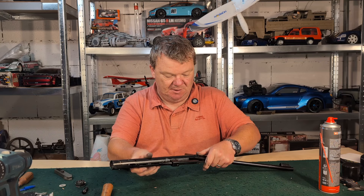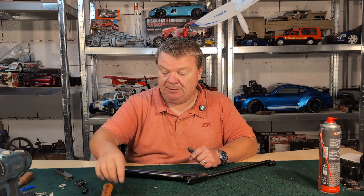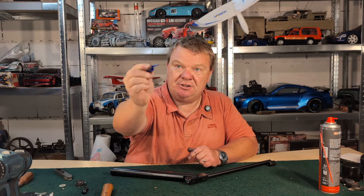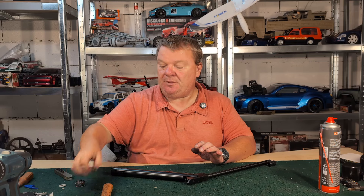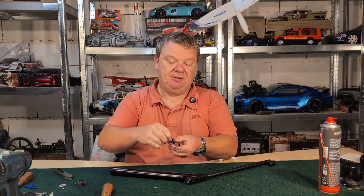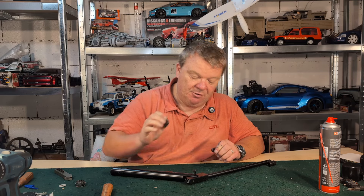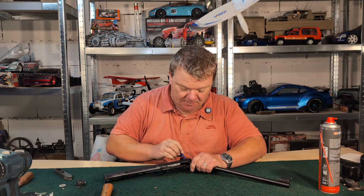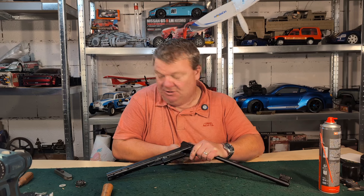That pushes through the tunnel and then drops into the piston — it's in its channel. Now we want to line up the barrel before we've put the spring into the gun, because then you're not fighting the spring on the detent that holds the barrel shut. We get our shim that we've just given a little rub with some Bum Slide, pop it there, and then we get our old friend the Bic pen lid. Use the sharp pointed bit of the pen lid to get it in there and then the rounded end to line it up. We take off the nut and one of the locking washers, give the shaft of the bolt a little rub with our Bum Slidey fingers before pushing it through. Then we flip her over, get our other shim for the other side, line it up with the Bic, push it up into the gap, and turn — that picks up the threads.